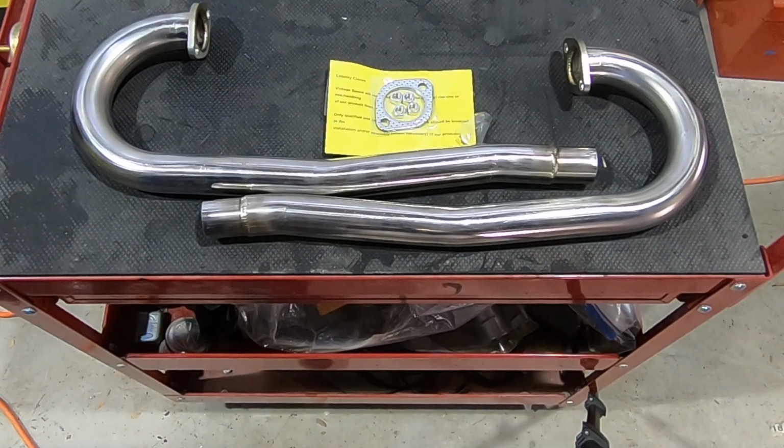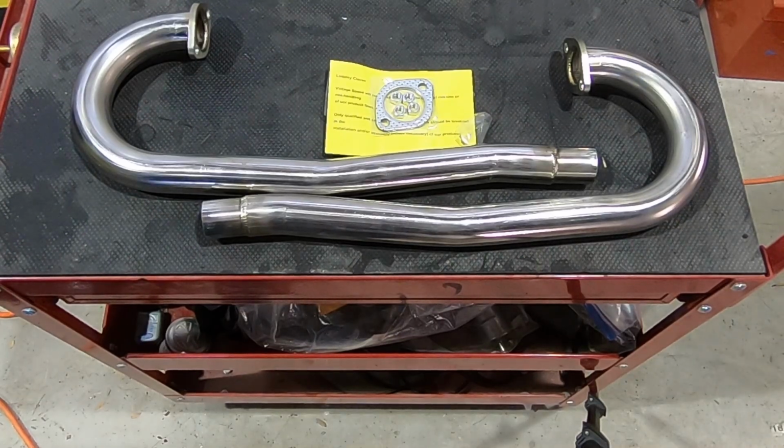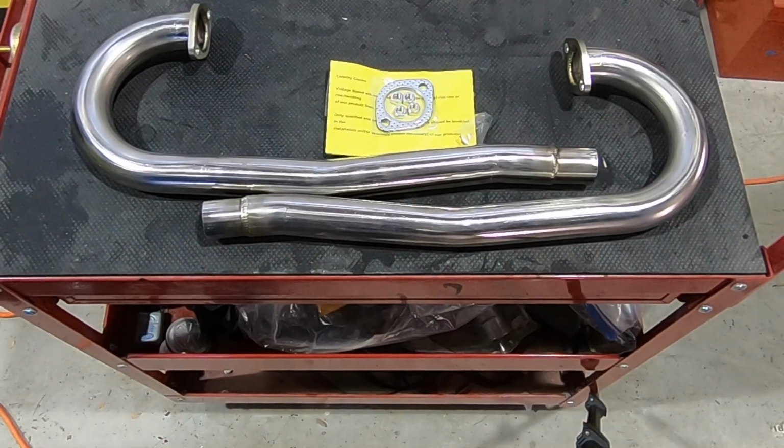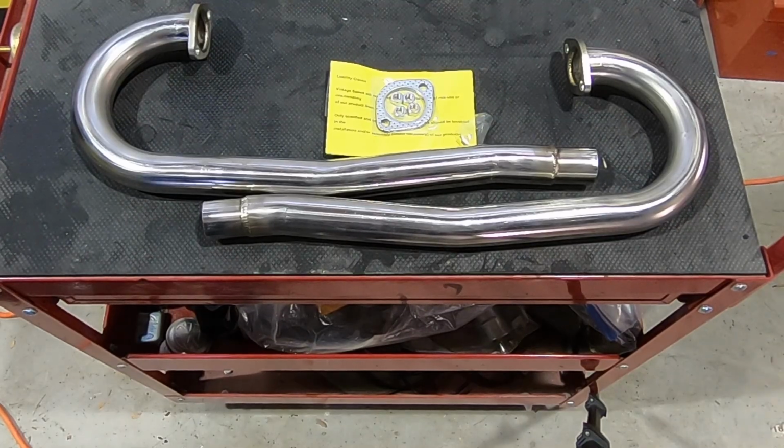Now the reason we are installing the J-tubes is one, it's a convertible. We'll only be driving it in really nice, sunny, beautiful days. We'll never really take it out if the top even has to be up. And being an auto stick, passenger side and driver side access is a little tight. Mostly the driver's side is your concern for all your adjustments for the auto stick. So while we're going through and getting this thing tuned in exactly, the heater box was in the way, so we're going to install these and make that a little bit better.